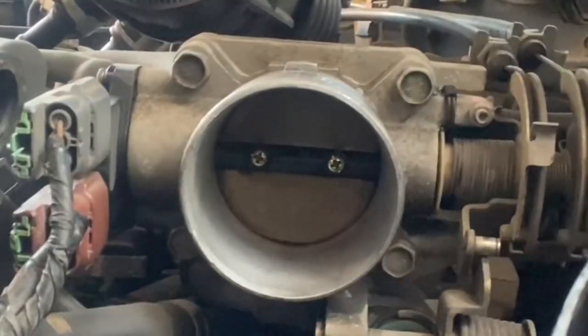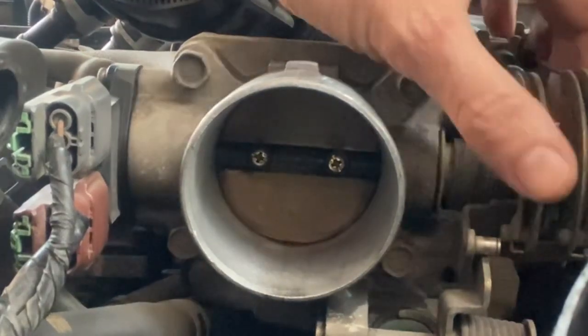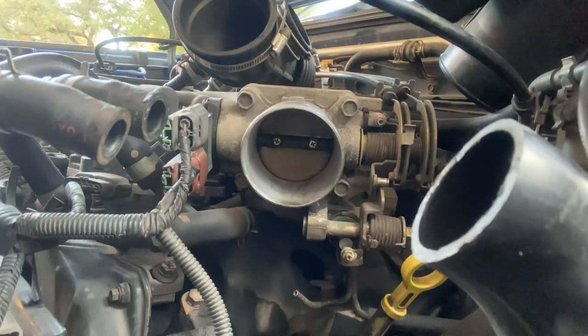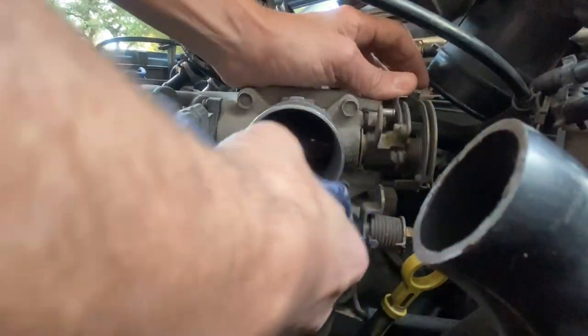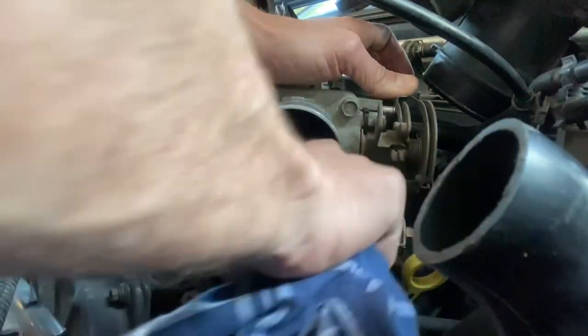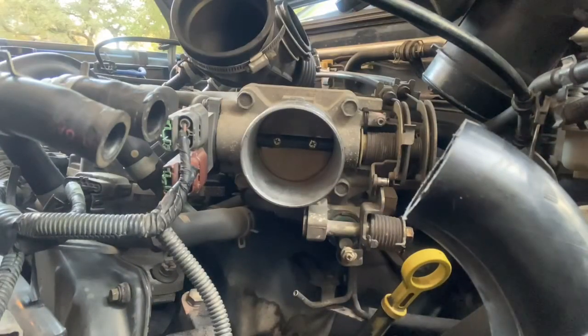That's the initial clean. The outside is clean, but that's not what's sticking typically. What's sticking is usually the edge of that butterfly. So what we're going to do is we're going to wet whatever we're cleaning with — the stuff evaporates real quick. I have to clean the edge of that butterfly and then I'm going to clean inside that lip right there where that butterfly seats. I can feel a ridge of debris and dirt in there. I'm going to keep doing that.